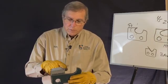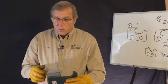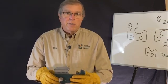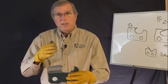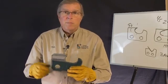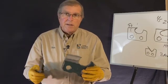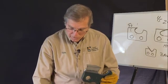If the operator continues pushing on the chain and more or less puts a rollover on the edge or a damage to it a little bit, then the grinder has to take it all off. And oftentimes you'd have to reset for every tooth, if you were trying to do everything evenly. But so they find the worst tooth, they start to grind on it, then they grind the rest. And yes, if you've got a lot of damage that way, it does tend to overheat the tooth if you apply too much pressure too fast. So you want to make sure that you remove it. And that's where I really started to use that flat file technique, is to take that damage off to use with grinders so it didn't overheat the tooth quite as badly. So that's something to consider.